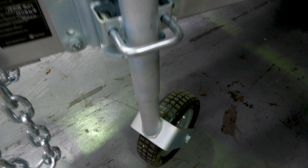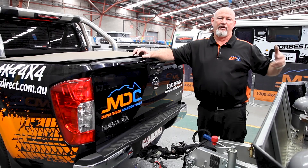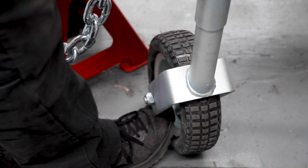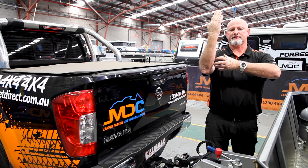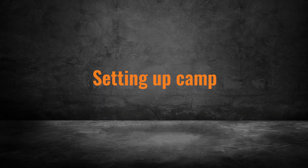On your jockey wheel: every time you take it off the car — whether camping or at home — have the wheel running crossways across your van, not vertical. It seems to support your A-frame a lot better. Also, when reversing on, if you miss a little bit you can move on the wheel itself rather than moving the whole jockey wheel. For safety reasons, make sure your jockey wheel runs across your van.